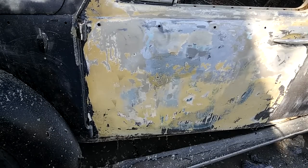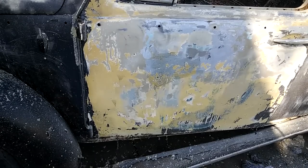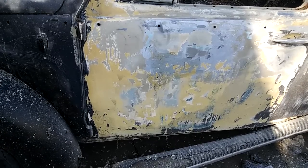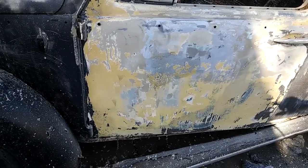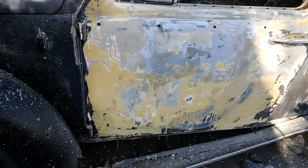I'm going to keep going with this and strip this car — I didn't even plan on doing this today, but I saw the interest you guys had in stripping cars and I saw how bad the videos out there are. It's not like stripping off two layers with aircraft stripper — try taking off 10 or 15 layers on a VW, which I know some of you are dealing with. That's the way to do it. With one more coat, it'll be down to bare metal.